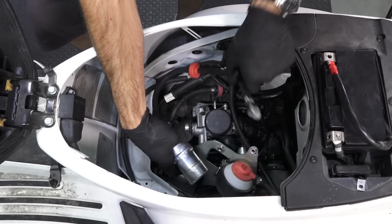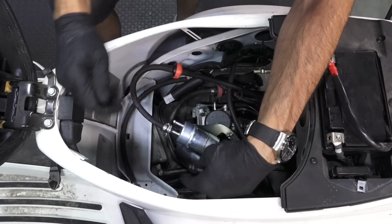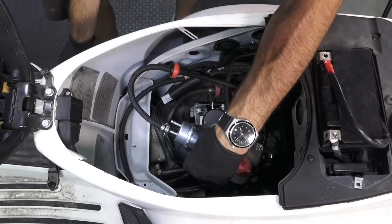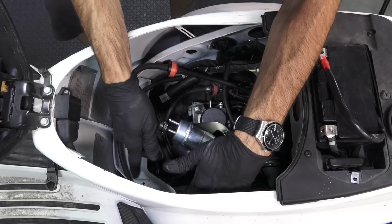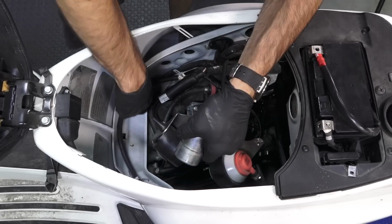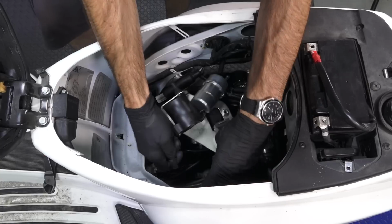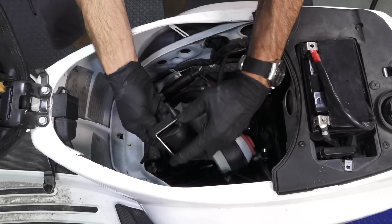Like I said, normally these fuel pumps are very, very rugged, but this thing's been disassembled. We just replace it with the less expensive vacuum fuel tap. So I'm gonna go ahead and eliminate this fuel pump and all the lines that were originally with it, get this all out of here. You can just leave the fuel pump disconnected. It's not gonna hurt anything.